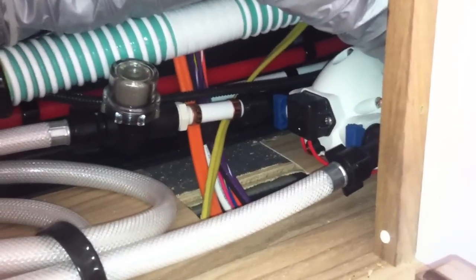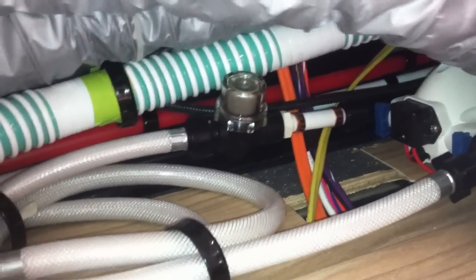The compartment right here below the refrigerator — when you open it up, it's got a little wall here. It's these couple of screws that I undid right there to access the panels and the pump right behind there. You don't even need the pump; you just need where the fresh water tank comes into the pump. I looked at the water pump, found where it's got an inlet strainer, and that hose goes around and terminates right here, which plugs into the fresh water tank. What I did is got a nylon hose barb for a half-inch, got some clear half-inch tubing that I'm going to run right down into my RV antifreeze and start the pump. Hopefully, that will draw everything we need in through the inlet strainer, through the pump, and distribute it out to all the various receptacles.